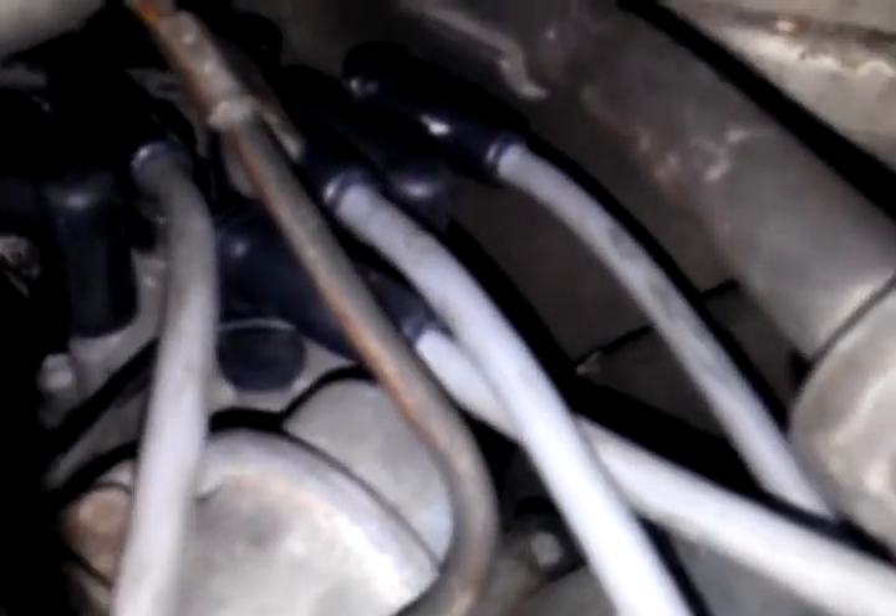The union has a little tiny piece on the inside. On this side I actually had to cut the lines all the way down to make sure I had a clean cut area so I could connect them without any leaks. Yesterday I went ahead and changed out the wires and spark plugs, and today I put on a brand new oil filter and did a complete oil change.